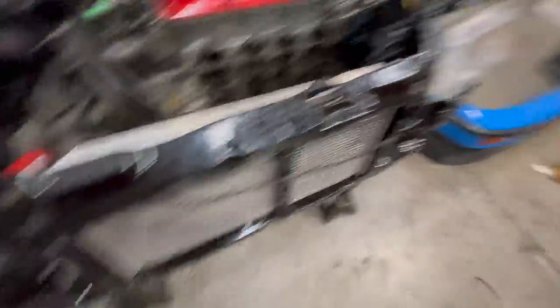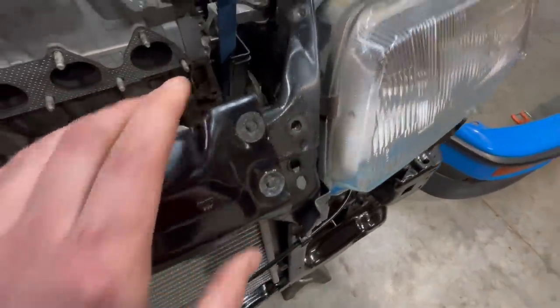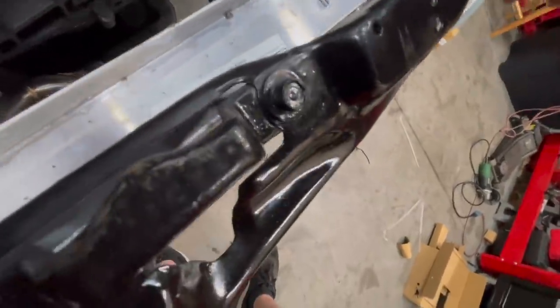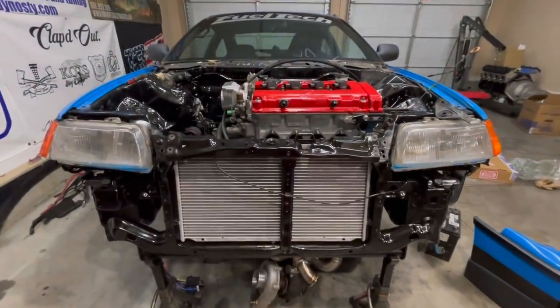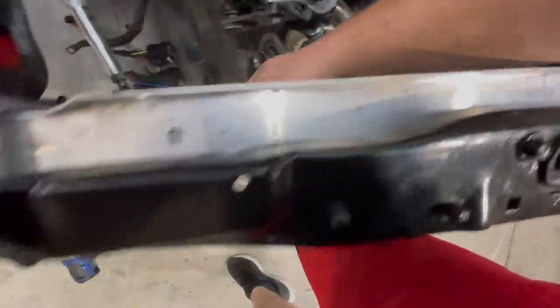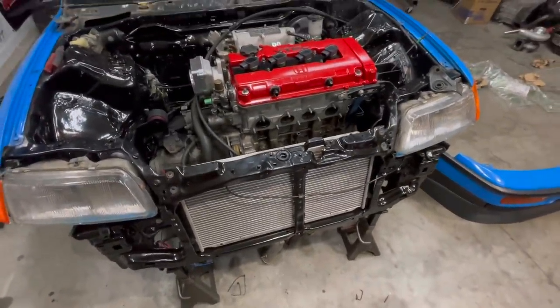Initial test fit — bumpers off. I need to get these bolt holes to line up, but the lip of the top piece that connects the core support actually hits the radiator. So I'm going to trim this section out so the radiator can actually sit flat. Honestly, this lip acts like a radiator hold to keep it from moving — so it may be two birds with one stone. The fitment as far as how much of the front end it takes up is really nice, and it should give me enough room to run a decent fan on this side and still fit intercooler piping through the other side.